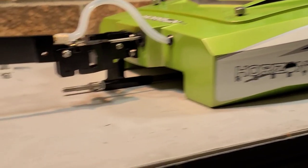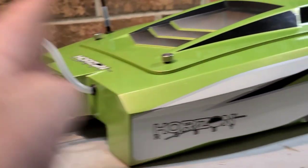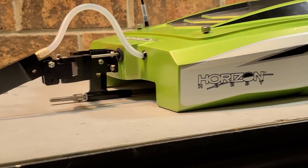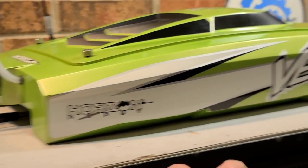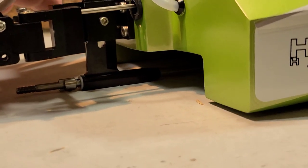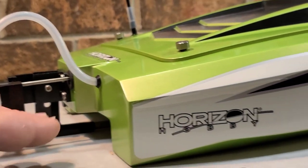I took the nylon breakaway screw and propeller off so you can see how the rudder kicks up if you hit debris — it'll kick up so you don't rip your hardware off the transom. Also notice how the strut is in line with the ride surface. Sitting flat on the workbench, the strut has no up angle or down angle out of the box — it's in a nice neutral position, actually down just a hair. We'll mess around with strut positioning on this boat.